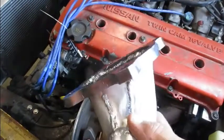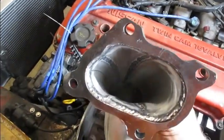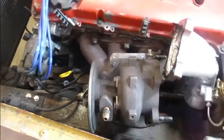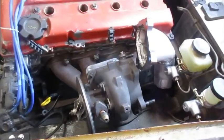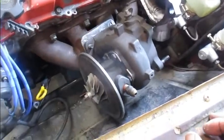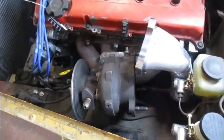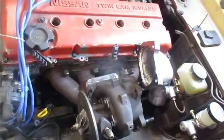So this is what we ended up with. Not my best welds, but not bad for working on garbage. Even though it's two and a half inch, it seems like it will flow pretty well. Next thing is I'm going to have to talk to a couple of buddies who are real familiar with this motor — we're going to do the oil drains and the infill for the oil. I want to find out where the best place is to get oil on this motor, see what kind of pressure we can get, and find out if this turbo can be overfed with oil. This one is not liquid cooled so it's oil cooled. I need to find all that out before I decide on using a 5/16ths line or a quarter inch line. Thanks, and I hope this motivated you to get out in the garage and do something to your car.